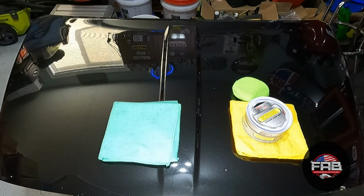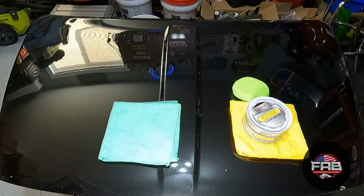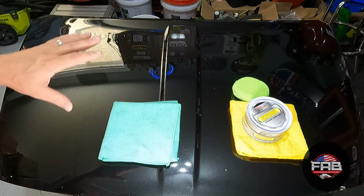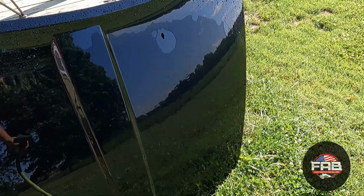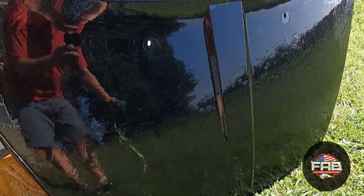You guys, if you notice this hood, this is the hood that I had in the video I did with the collaboration with Pan the Organizer when I put 3 different ceramic coatings up against each other, hit them with a bunch of chemicals, then actually lit it on fire. It's been sitting around for a while ever since then, so I have polished it, completely removed anything that's possibly left over. The fire pretty much did the majority of the damage anyways, but I did a heavy polish, a fine polish, and then I hit it with the paint prep 3 times. And then as you can see in the video right here, there is nothing left on this panel. The panel is completely stripped. The water is just sitting there flat, and now we're ready to apply these.